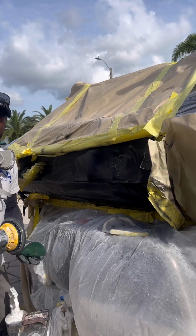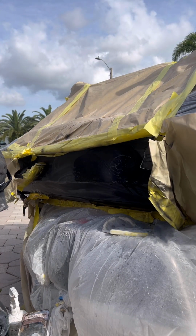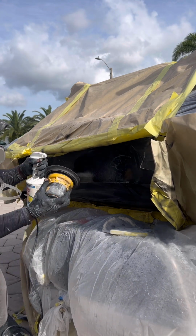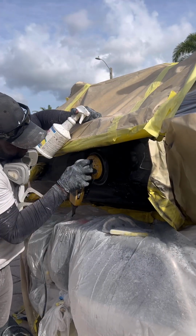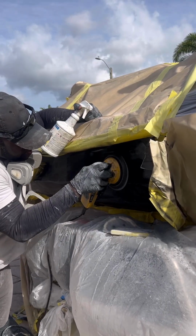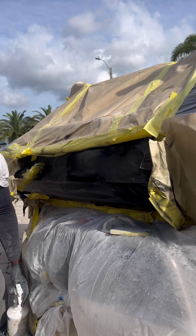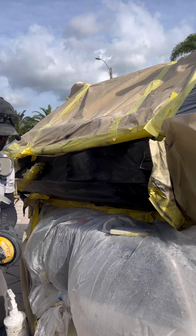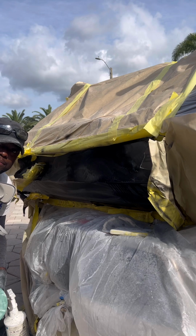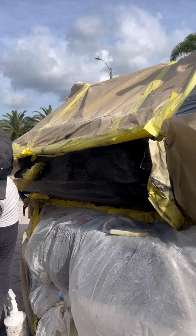Oh yeah, for my sandpaper, I'm using 320, 400, 600, 1200, and 2000. You're probably asking why so extreme. Black is a very difficult color to repair because it's easy to scratch and you will see all the sand marks in it when you buff it up. So by using the 2000 and 1200, that helps me knock down the heavy grit sandpaper marks.